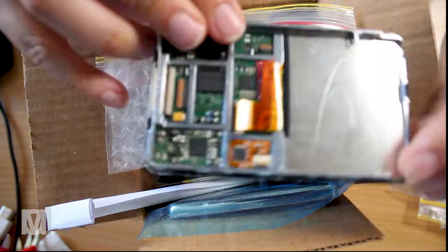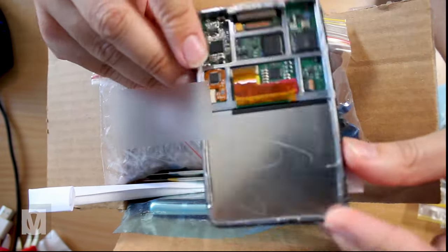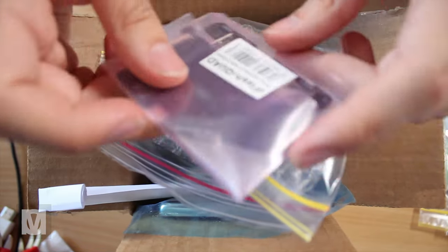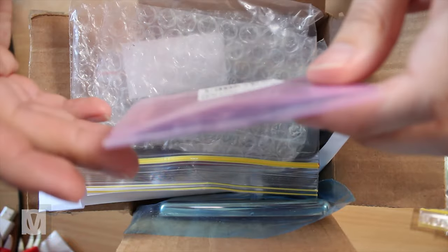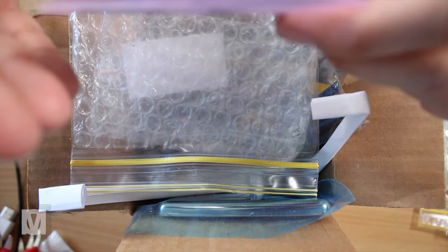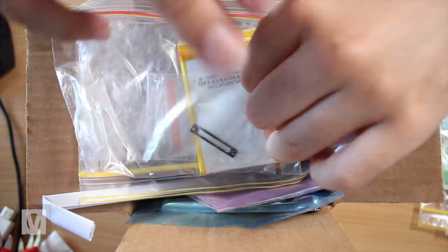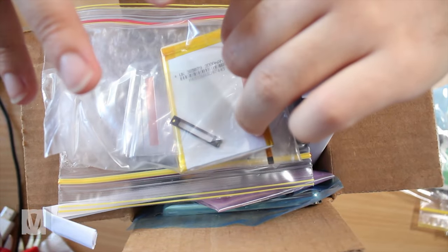I decided to use this iPod classic front panel and chassis for my project. I'll be removing the main board as it is fried. To build a thin iPod classic and implement a 3000mAh battery, I have to use the iFlash quad micro to keep the thickness down enough for the thin case. The battery and dock bezel are both from EOE Works — great customer service, I recommend.